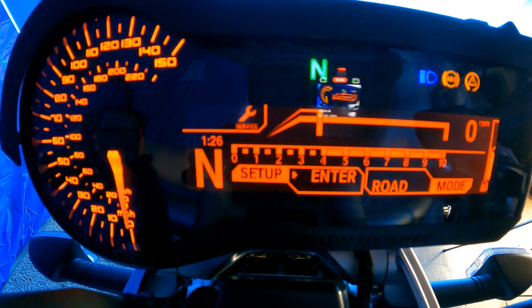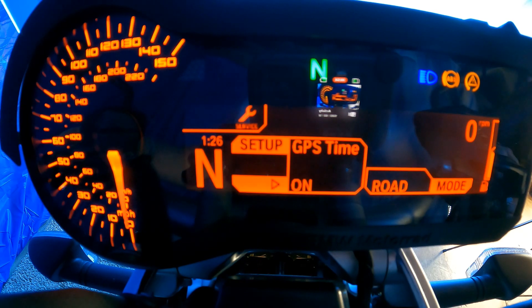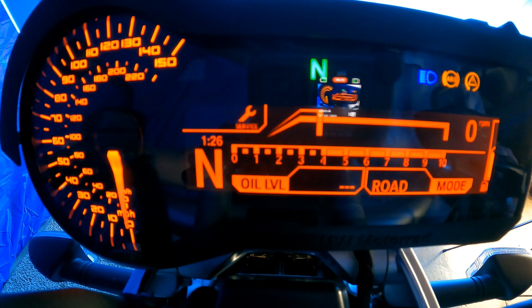I'm going to go back to the setup menu by pressing and holding the trip button to enter the setup screen. If I were to select info, I could change whether my GPS time is off or on. Instead, I'll press the trip button to cycle through selections: GPS time, user mode, clock, date, shift indicator, brightness, clock format, date format, and then here's BC Basic. If I press the info button now, we're at BC Pro. I'll press trip again to continue cycling — reset and exit. I'll press the info button to select exit, and now we are in BC Pro.